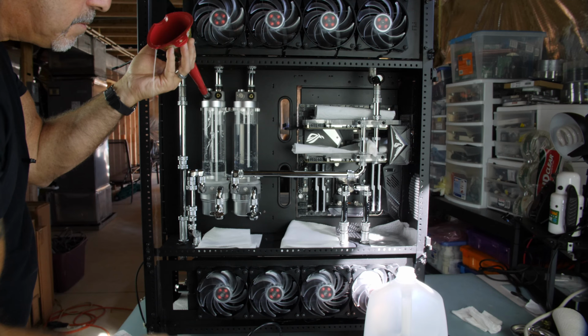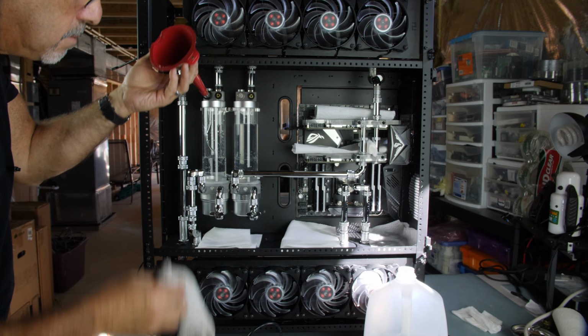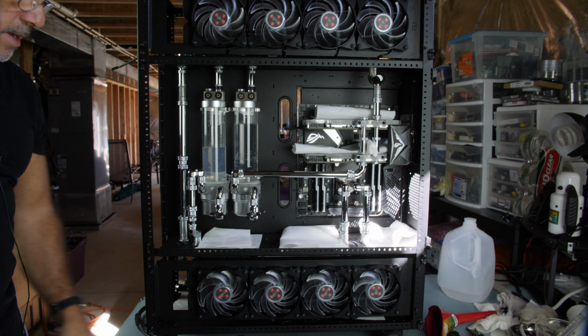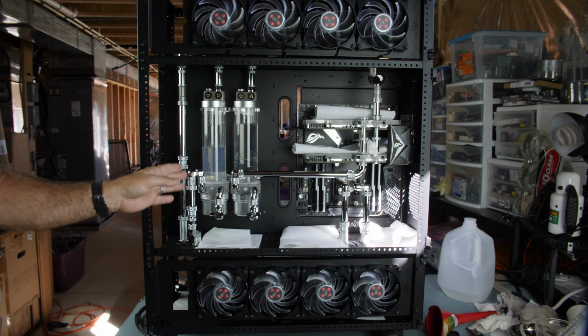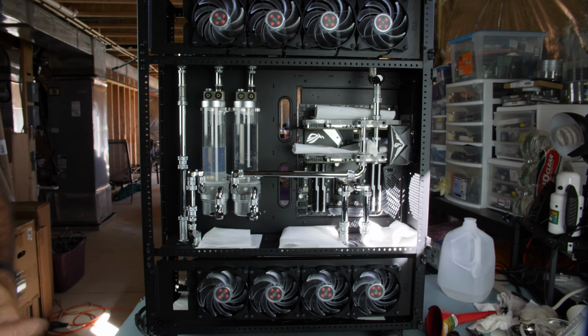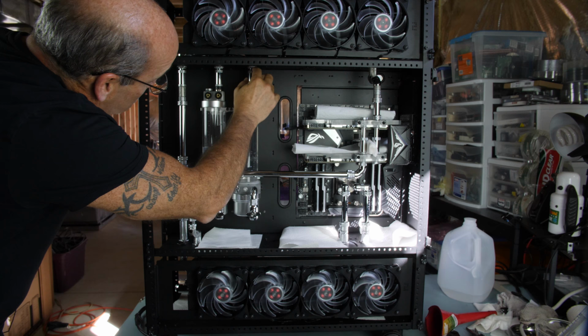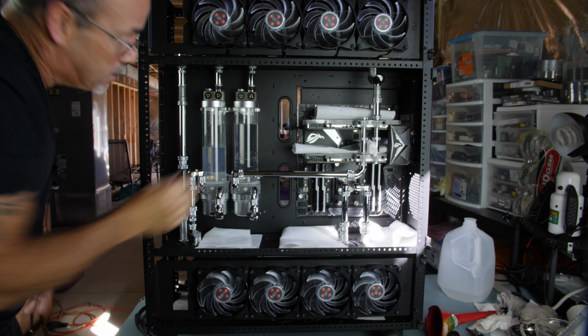That's my fault. Power splitter back here. So coming out of my pack, I can power both pumps now. And it looks like the CPU loop is doing fine now, aside from that drain plug leak from not having it tightened up properly. And the GPU, we'll see. The only area I'm still having some leakage, and I tried to tighten it down as best I could. Again, I'm going to have to get a pair of pliers if I need to tighten up this fitting near the top. But let's give it a shot.